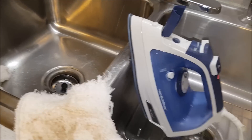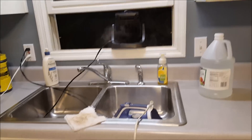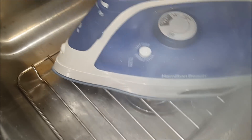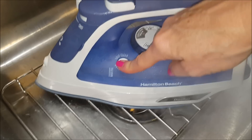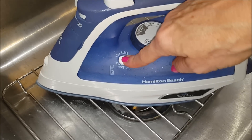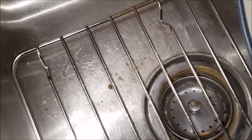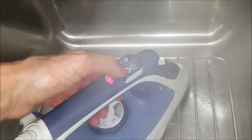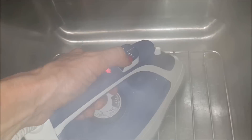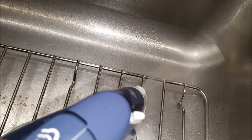I tried setting the fan in the window to suck the smell out, but it wasn't drawing out the vinegar steam like I thought, so I moved it back - I think it did better pushing air in. This iron has a self-clean feature but I don't think it really works well with the type of water we have. I really need to start putting distilled or bottled water in here. You can see some of the stuff coming out of the bottom. The spray nozzle on the front had been clogged up pretty badly but I just finally got it to spray - so the vinegar is working.